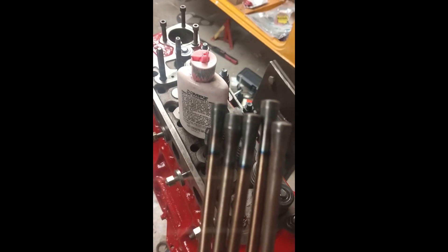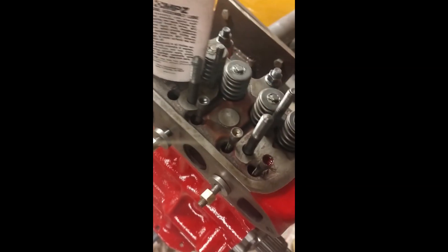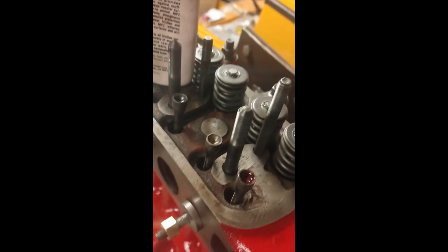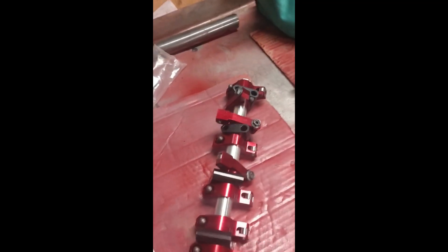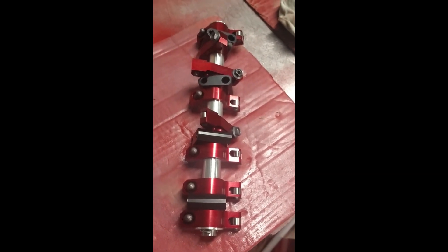The head is now going on to my turbo build. I've got a nice set of pushrods that I bought from MED — really nice quality, replacing the old style which can bend. I have got double springs in this one as standard. Although they're not too aggressive, you do find that with some of the really aggressive springs they can bend the pushrods — I've had that in the past. Also going in is a nice set of roller rockers with a ratio of 1.3 to 1.